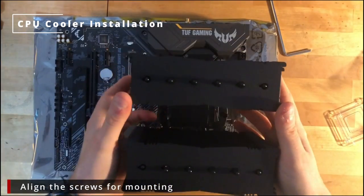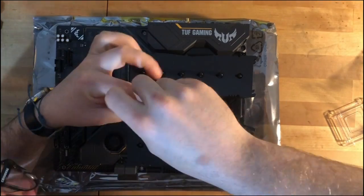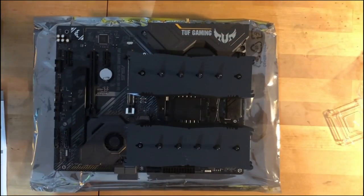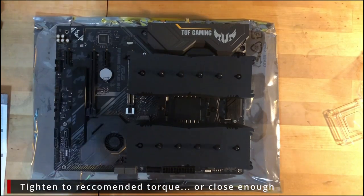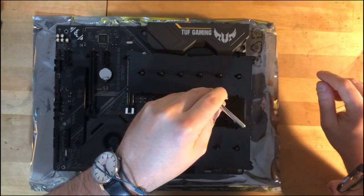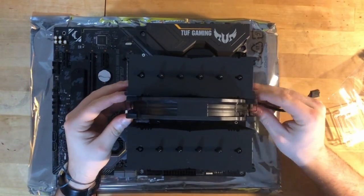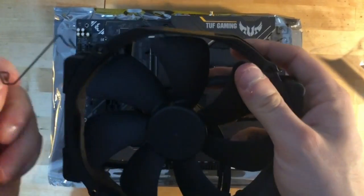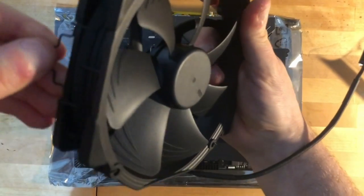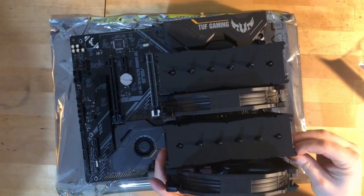This is actually quite hard to line up, so just do it by eye so the screws line up and then gently screw it down. There is a recommended torque for this, but unless you've got a torque wrench, just don't over-tighten — you don't want to damage anything. Then reinstall your fans — they just clip on. The other fan didn't have the clips installed so you just line them up and clip them onto the heatsinks. Make sure the airflow is consistent and check the arrows on the fan to make sure it's in the right direction.